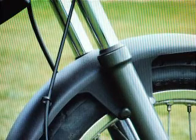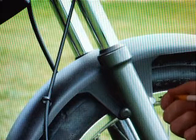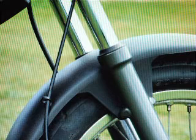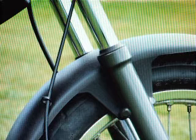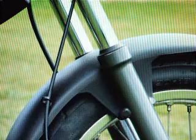I've also noticed that the front wheel is very slightly out of true. If you were to hold a pencil on this edge there and spin the wheel, it's probably about a millimetre to a millimetre and a quarter out. A bit of sideways movement there. I don't think it would fail an MOT, but you might want to check if you're concerned about it. You might want to get it trued up at some point, certainly before the MOT, which is in a couple of years' time.